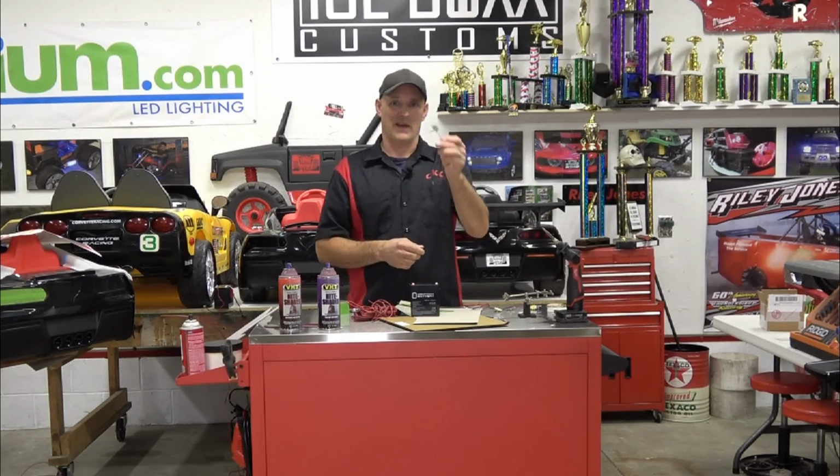And this one, brand new, was dead. No good. So I would hate for you guys to do all this work, glue it in, solder it up, go to turn it on, and one of the LEDs doesn't work. So please, you know it comes from China. Everything comes from China. So test the LEDs first.